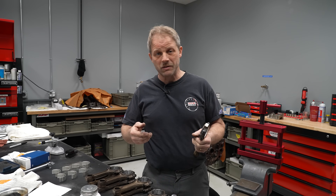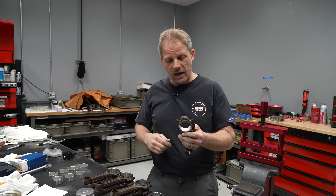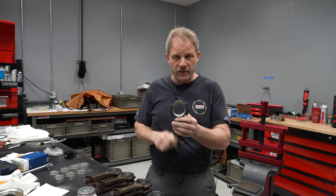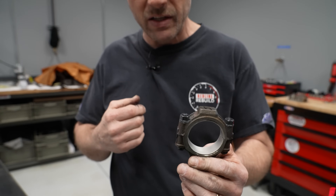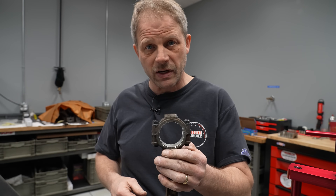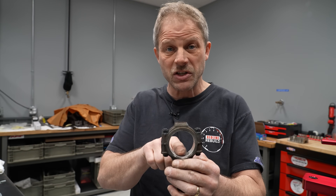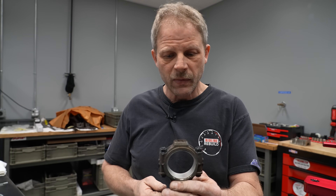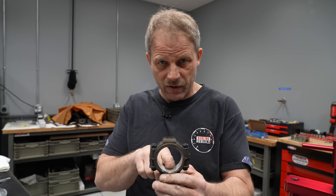To have it ground, he needs some direction — he can't just cut it willy-nilly. So what I'm going to do today is go through my rods and my mains with bearings installed and measure the bore diameter. The initial jump from standard size is ten thousandths, so we're going to grind our crankshaft ten thousandths. These bearings are ten thousandths oversized, meaning the diameter will be ten thousandths smaller than GM stock.